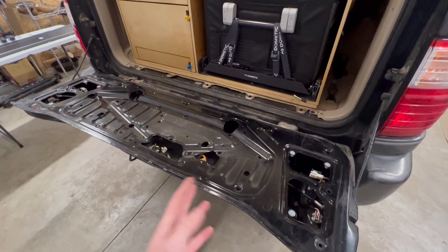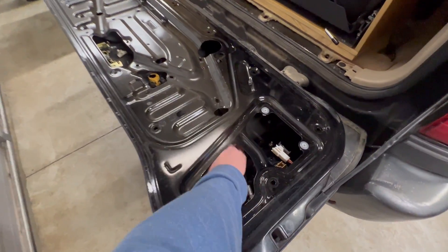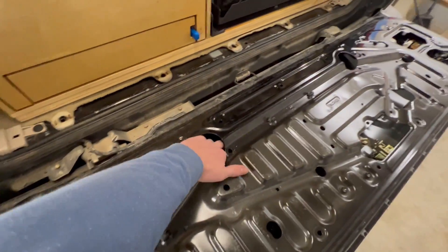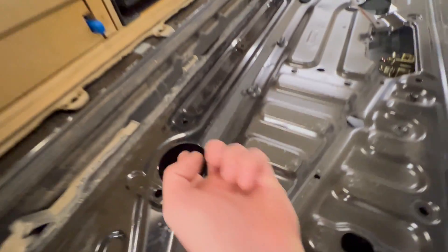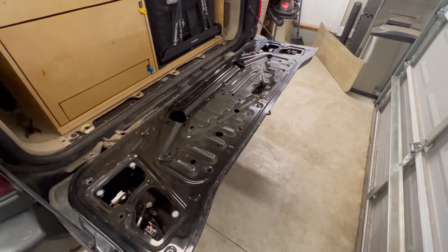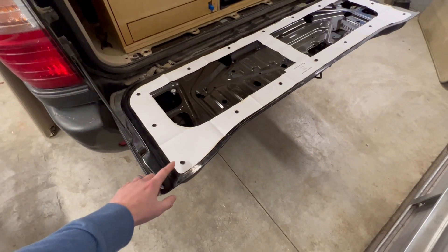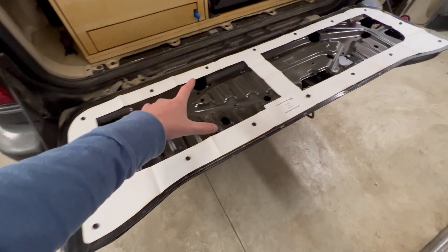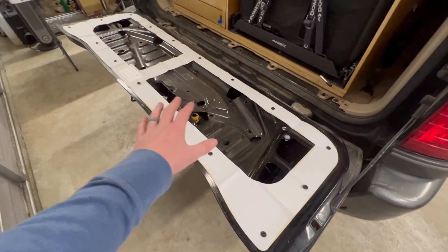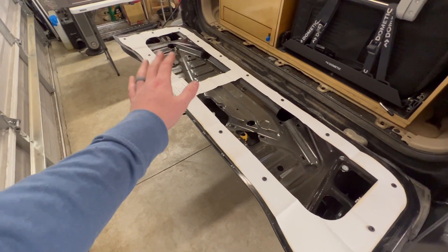Here's what your tailgate should look like when all lock cables and harnesses are hidden. I used the holes to stick my hand in and make sure they were routed properly and not near the edges where I'll be cutting — the last thing I want is to damage a harness or lock cable. Template is installed using the included fasteners in every single hole so no part of the paper is stressed more than needed and it's perfectly located. Next step is to trace it.